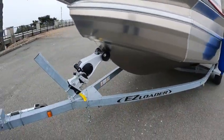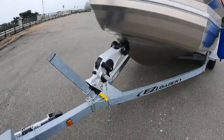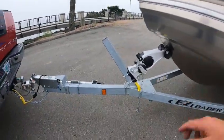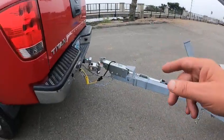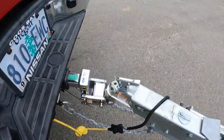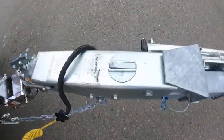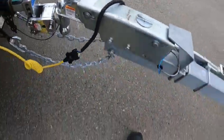Two-speed Fulton — ideal, you gotta love them, they don't rust on you. You got that extra low speed so none of that hard cranking. Top mount coupler, two-inch ball, peek-a-boo hole, standard flip clip — put a padlock in that. Check your brake fluid up underneath there. Backing removed — that has to be pulled all the way ahead.